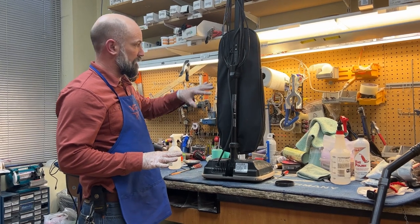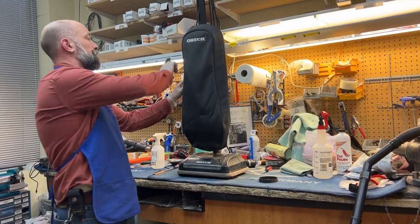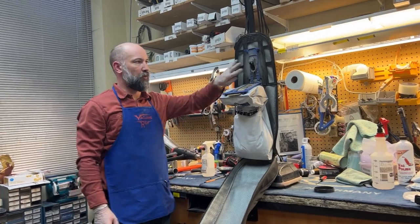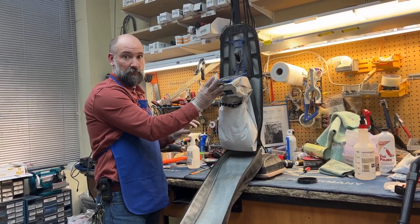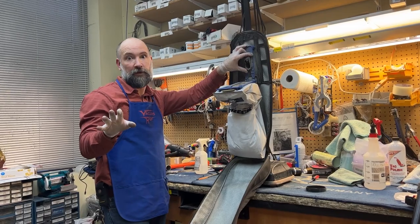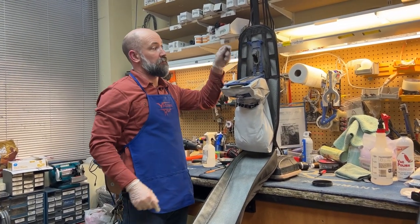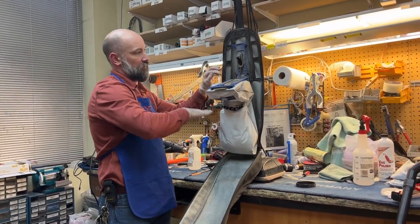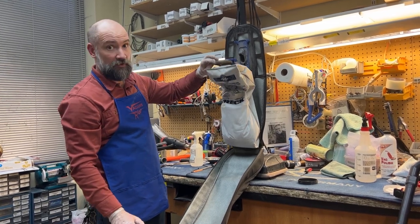So if you've verified that you have a clog up here, you can pick it out with needle nose pliers. One thing you can do is take the machine outside, take your bag off, plug it in, point this away from anybody, and turn it on. By removing the restriction that the bag provides, you can sometimes get the machine to just shoot the clog out. I warn you — it will shoot 15 or 20 feet, so take it outside and point it at the yard. You may be able to pick out the clog here, turn it on, and it'll shoot out. Sometimes you remove the clog, turn it on, and there's more clog down in the tube and it'll push up. You can pick some more out, turn the machine off, pick more out, then turn it on again and it'll unclog itself. That's super easy when that happens.